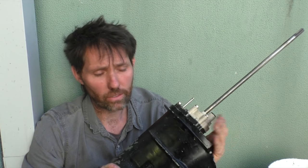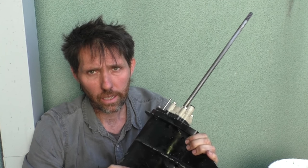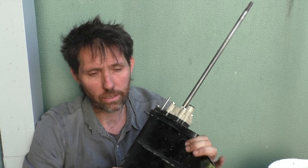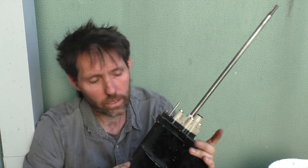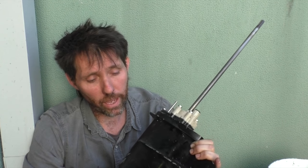So that's about all I wanted to say for this video — just a little midweek extra in between the restoration project. I just wanted to go through that so that when people say they've done a test and their pump's not working, just to make sure it really is a problem with the pump and not people doing the test incorrectly. Other than the water level, the important things are: select neutral so you don't have the prop spinning around in the bucket, and also know which way your outboard goes. Most outboards go clockwise, but just do a little bit of searching on the net and make sure you've got it correct for your outboard.